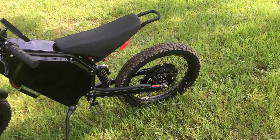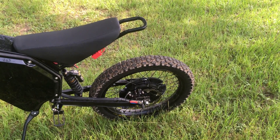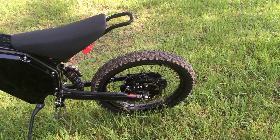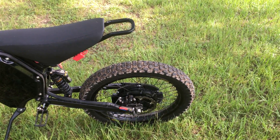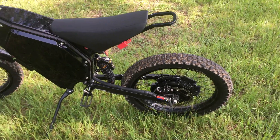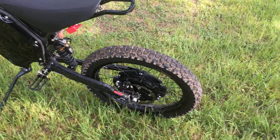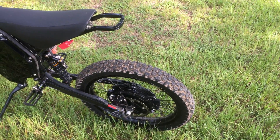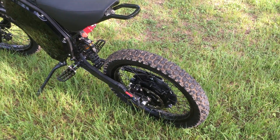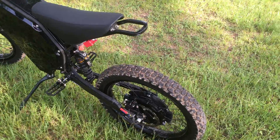I've got heat sinks and ferro fluid on the hub motor. It's still thermally limited — I have it set to start cutting back on throttle at around 100 degrees Celsius to prevent it from getting too hot. I don't know what temperature the laminations will really start to fry at, but I'm guessing you don't want to go much over that. Down here in Texas it's real humid and real hot, so it doesn't help cooling at all. The ferro fluid made a pretty noticeable difference — I ran for a while before I injected it with just the heat sinks and it would get hot real quick. Now I can pretty much ride around all I want as long as I don't go too hard continuously, or at least let it coast down and get the temperature back down to 80–90 Celsius.